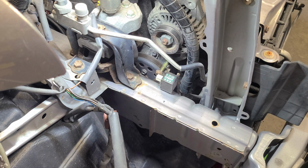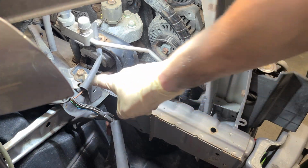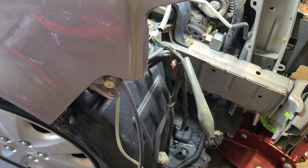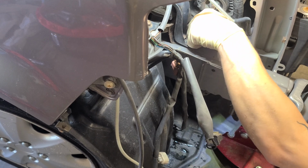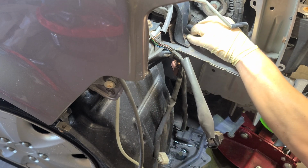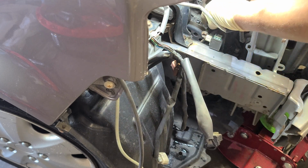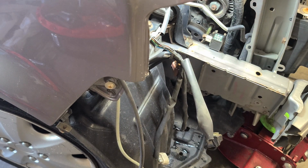Okay, we're gonna take this motor mount off just a little bit. We're not gonna take it all the way out. I'm just gonna back up the bolts a little bit. Yeah, and I believe those are 15, so you got one here, one in the middle, and one on the other side over here, straight down there. So let me loosen those up just to get them up high enough, and let me support the bottom a little bit. But it's always just this little bitty stuff like this. And I wish I could just come out with it. And whoever put this there, I guess this airbag sensor is just, I might be able to work it. Let's see if I can work the alternator a little bit. And if it's longer than a couple seconds, actually I might be able to work it back. Let's see. Nope, still in the same predicament. All right, so let's see, 15s it is.